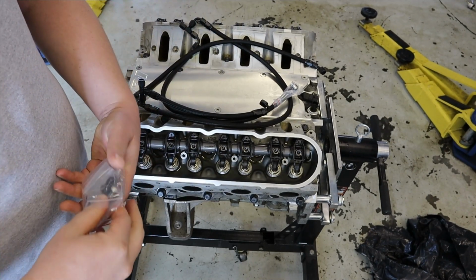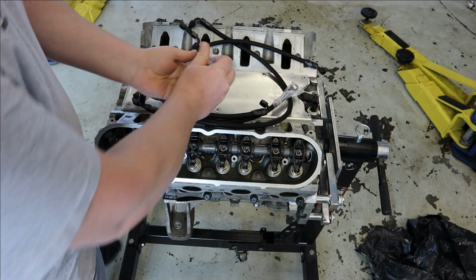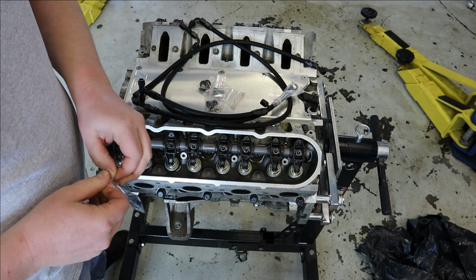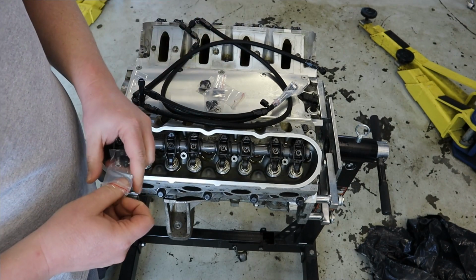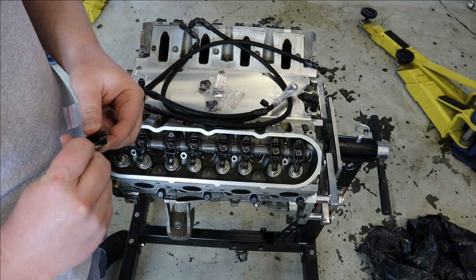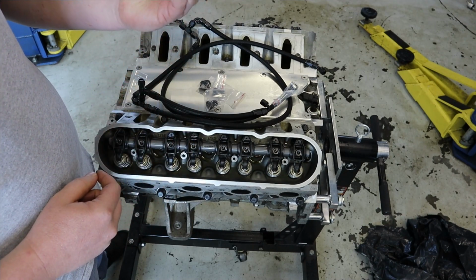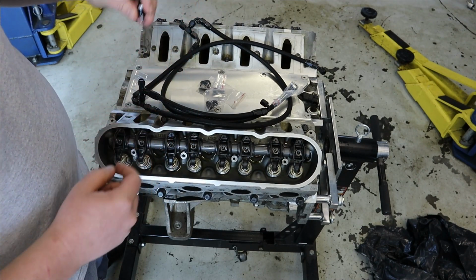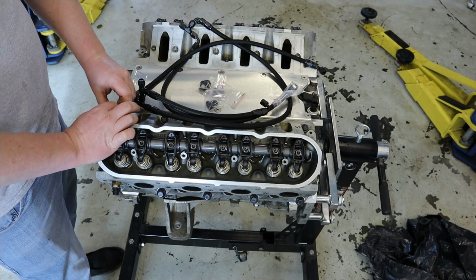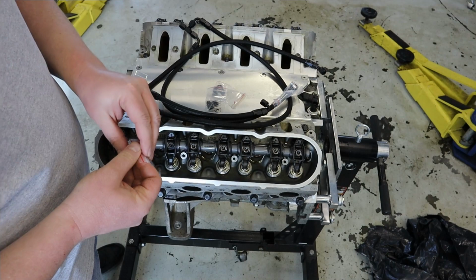or also to prevent air pockets and whatnot. So when you change intakes, well, most of the time the back ones are blocked off, I believe, in most cases from the factory. In a racing scenario, it's best to use all 4. So there's lots of companies that make kits for these. This one uses relatively short little fittings and converts them to AN. So all we got to do is pop these on the corners, tighten them down, and then hook up our lines.